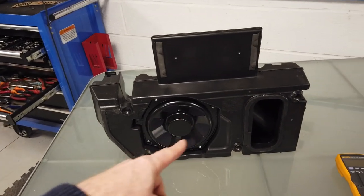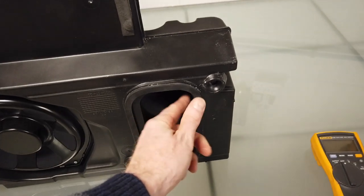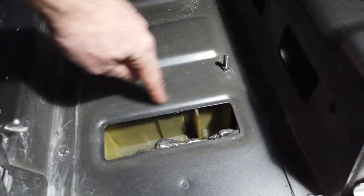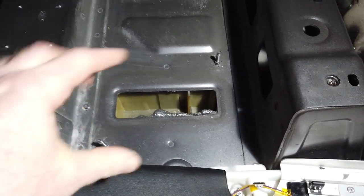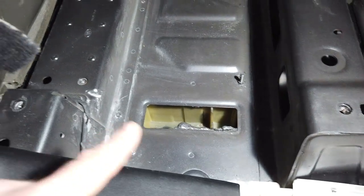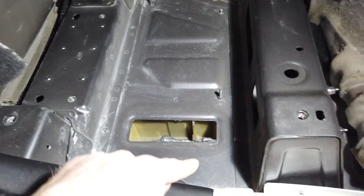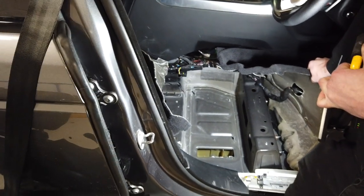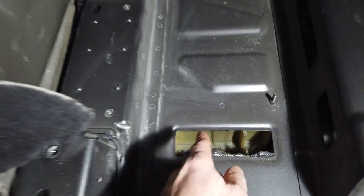One little bonus feature of note: when installed in the car, the speaker faces downward. You'll see it's got a slot here with tape around it. In the floor of the car there's a section that goes into almost the chassis rail underneath — so Land Rover is using the chassis rail as part of the bass transmission. They obviously needed extra volume for the subwoofer and have used an existing cavity in the car. You can see where the seal goes around the slot. Ten out of ten to Land Rover for that — and this sealant is where they've sealed the floor to the chassis.